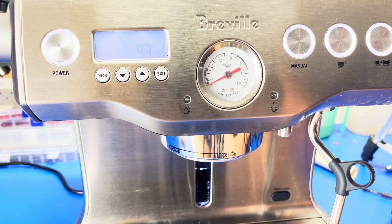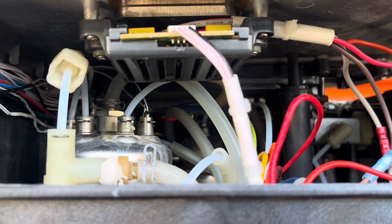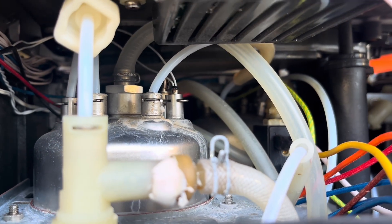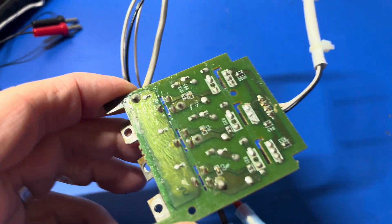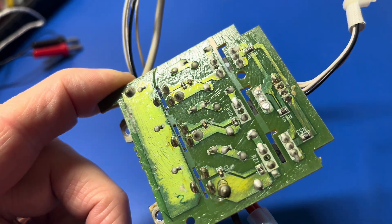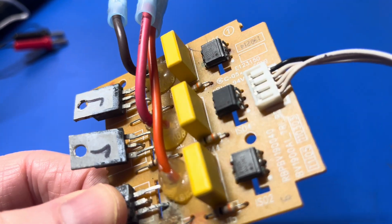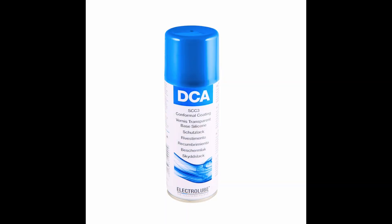Before we cover prevention, let's summarise why this happens. By and large, the vast majority of people watching this are here as a result of leaking o-rings. Water leaks coupled with the location of the triac board are a recipe for disaster. We can prevent this in two ways. The first is the lack of conformal coating on the component side of the board — Breville waterproofs the underside, but steam is often getting inside the enclosure and condensing into water right around the components. I found a silicone-based high-temperature coating online — link in the description — and a couple of coats of this should stop the problem from happening again.